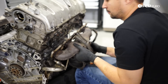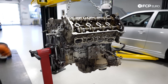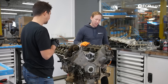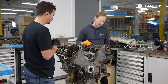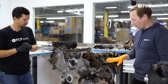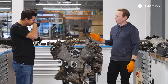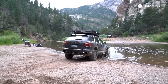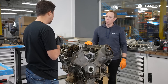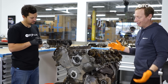We got a lot done. It looks more like an engine now versus an engine with piles of plastic, vacuum hoses, evap hoses, and wiring harnesses on top — all of which were very brittle, which we found out. We've got our valve covers off, camshafts exposed, a couple of timing chains, and everything. And surprisingly, it looks better than I would have thought. It wasn't like it was turning at high RPM or running for very long with water inside. Once we get the cam caps off, we'll see if there's any actual wear.